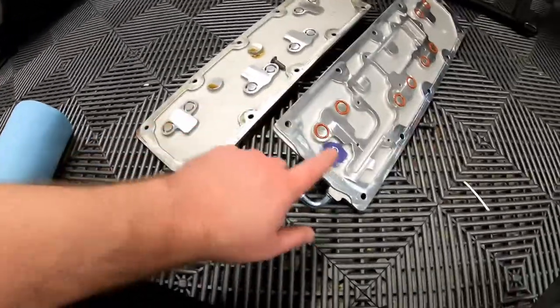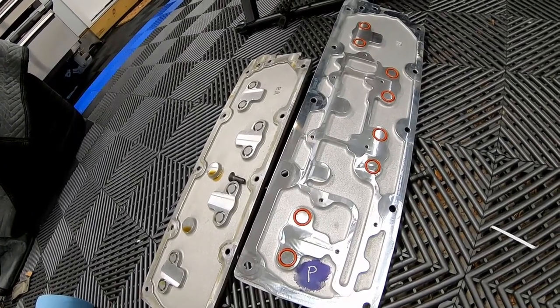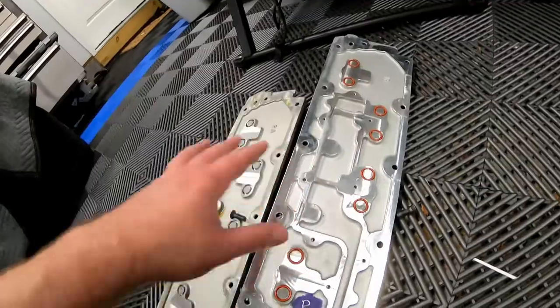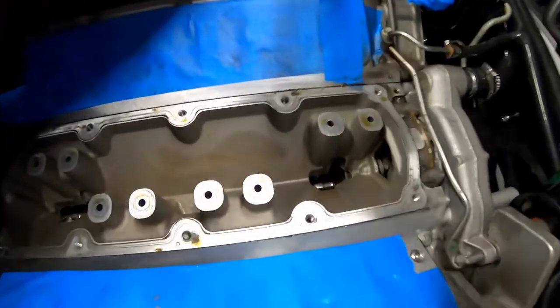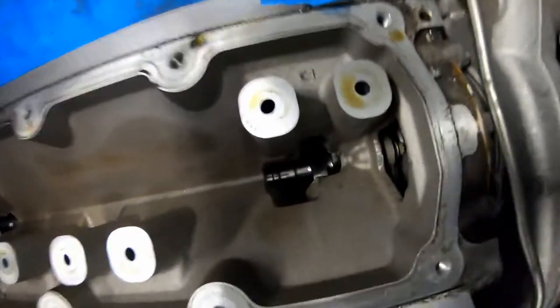Here is the old original plate. I transferred the O-ring gaskets from the old plate to the new one — they're all in the same spots. I also noticed the new plate has extra webbing for the active fuel management or displacement on demand systems that come on automatic Camaros, which is a little weird to see on the Corvette since the old LS3 kit plate was flat with no extra casting marks. The motor is looking clean after five or six years of a supercharger on here — no issues from up top. And you can see the LS9 camshaft down in there, which we installed a long time ago.